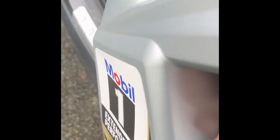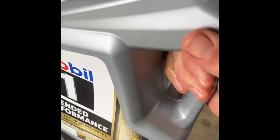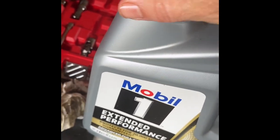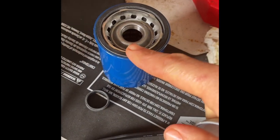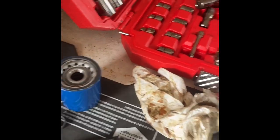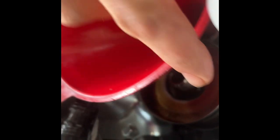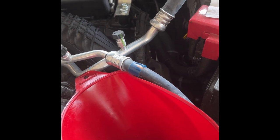It's very important that we always put the right type of oil in — as you can see we've got some 0W-20 here. Some people put the filter in now because you do have to get a little bit of fresh brand new oil on your finger: open up the oil, remove this seal, and rub a fresh coat of oil on the gasket so it slides as you install it and doesn't pinch and bunch up creating an oil leak. The reason I don't put the oil filter on first is because of where it sits — it's just more in the way of your funnel and makes it even harder to fill. So I'm gonna fill first with the proper amount of oil and then install the new filter.